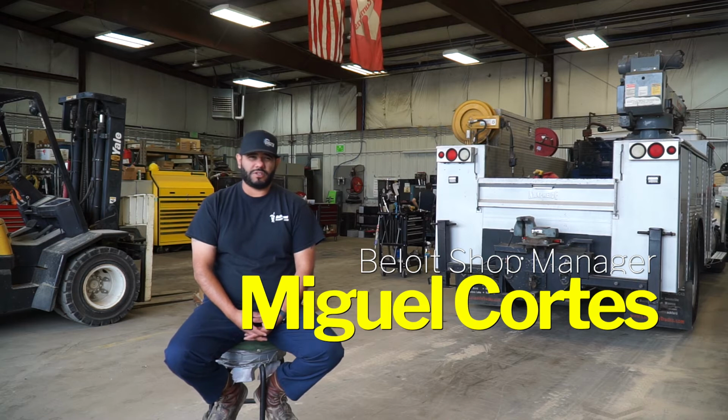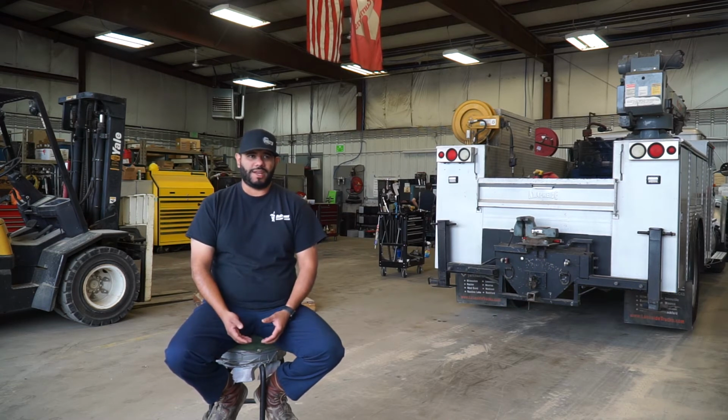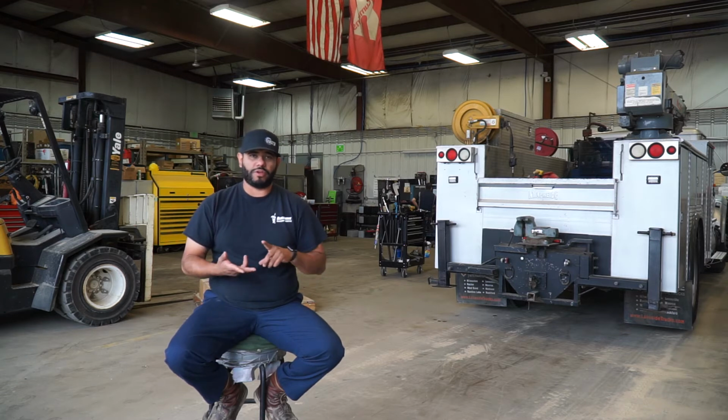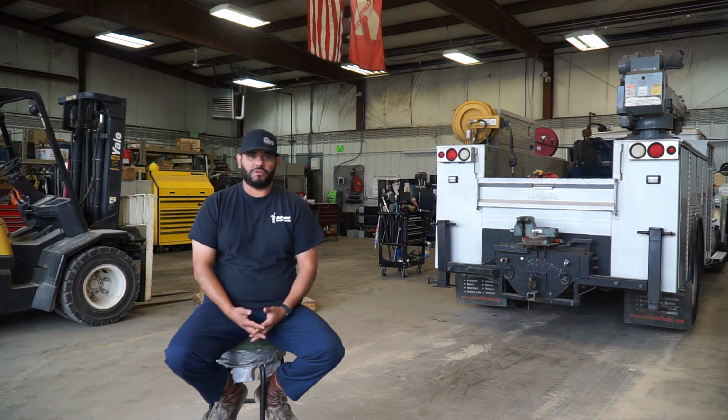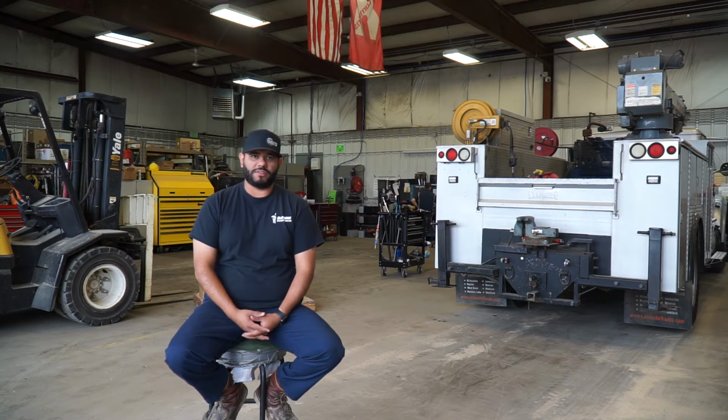We got National Brake Safety Week coming up this week, so just make sure when you guys are doing your pre-trip, you can actually check your brake pads or your brake shoes on both the truck and trailer. First things you want to inspect: make sure there's no glazing on the drums and no actual cracking on both the pads or the shoes. I mean, you got to get a little dirty, but it's better to be safe than sorry and help you guys from getting any trouble down the road.